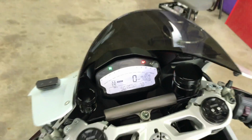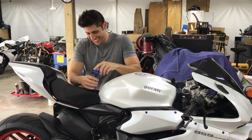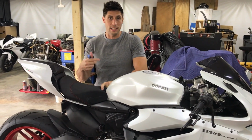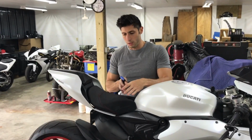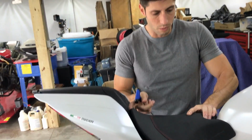So we let the bike cool off a little bit. We let Nia drop her bike on the ground. We're going to pop off the seat and add some heat shielding under this. I was asking him if he thought it would actually make a difference, and he said absolutely. It'll keep the heat from funneling up through the seat, and it'll funnel it through here, and there are 2 little areas that allow it to get pushed out with the wind, which is really nice.